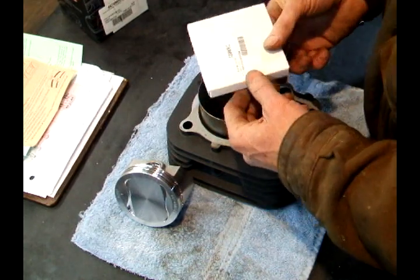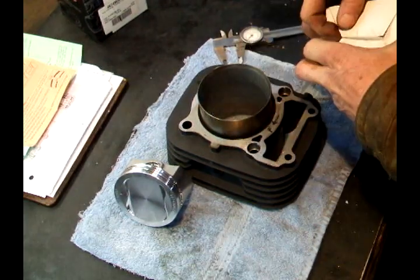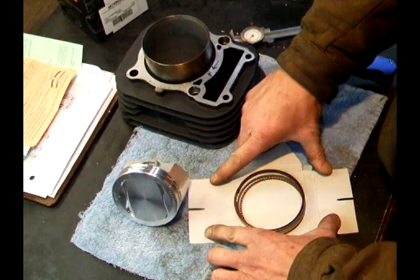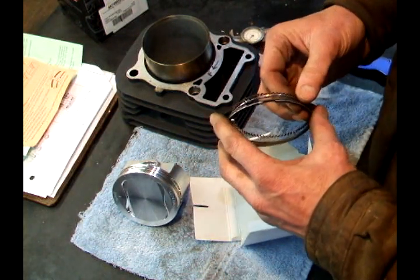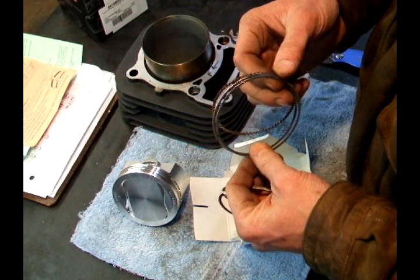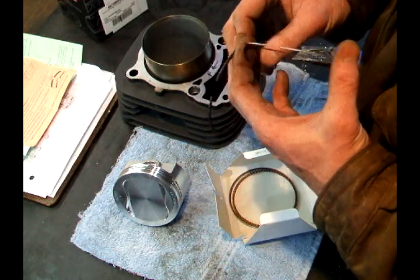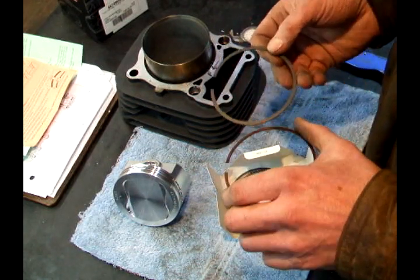The next step of this process is fitting the rings to the cylinder. Take your time doing this. We're going to open them up and see what we got. It's a four-stroke engine, so there's basically five pieces here. The thin ones with the corrugated section are the oil wiper ring — we'll check those last. Then there's a chrome ring which is the top compression ring, and a cast iron ring which is the second wiper ring.